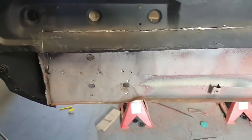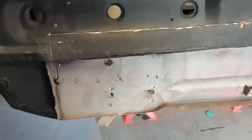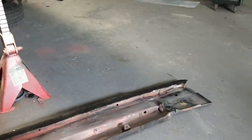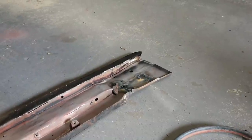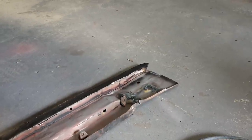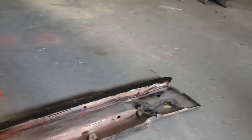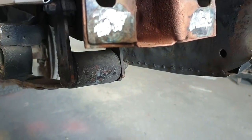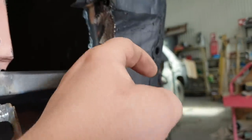The joys of being on your side of the computer, you get to see it done rather than having to watch it all. So you may notice that that is now on the ground. I did actually have to use an oxy to get around the welds. If you're very, very careful with a cutting torch, and you have to be really quick, you can just zip around the welds and blow off the top layer of steel, but without wrecking the stuff behind it. And then I've just got a grinding disc and just ground off the red. I'll tidy that up a lot better before I put the next panel on. And now I'm just working my way up the sides to get the remnants off here.